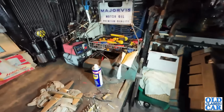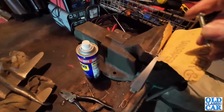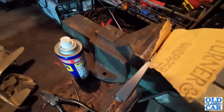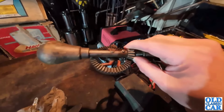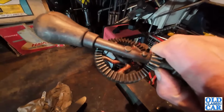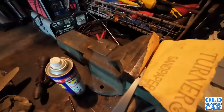Right, well, I've probably worked my way up through about 6 different drill bits to get to the hole being that large, but it's still not quite enough to sneak that through. It's very, very close. So I'm going to go up to another drill size, but there's so little meat left to play with that I'm going to break out a proper old-worldy hand drill, nice small one. So the final hole, using this drill bit here, I'm going to use this. Just go really, really slow and see if I can open up this without splitting the plastic, which there's probably a 50-50 chance of this working.